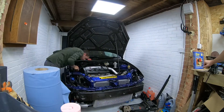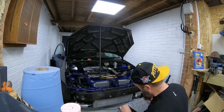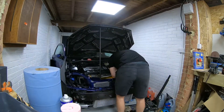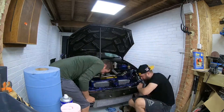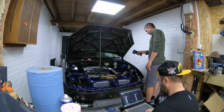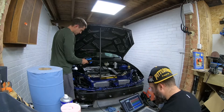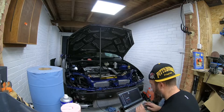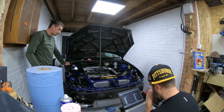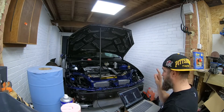First time using a microphone — I feel like an old school MC. So this is running through all the sensors doing all the pre-first-startup checks. You really want to take your time here, and getting a mate to help is imperative. Go through and check all your temp and pressure sensors — air inlet temp, water temp, oil temp, oil pressure. MAP is already running and showing 14.5 psi atmospheric. We're using a cheap surface temperature sensor and figured out it's wildly inaccurate, which puts my previous sensor calibrations into question, but I'll recalibrate in future.